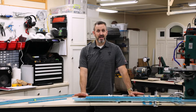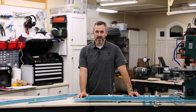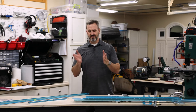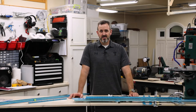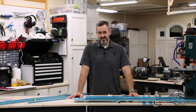I'm going to start building the empennage and I'm about to start making my first cuts, pound my first rivets, and do all that kind of stuff. The instructions for the empennage start you off building the horizontal stabilizer, and then the rudder — that's Section 6 and Section 8 in the manual. I have the parts for the horizontal stabilizer and the rudder right here in front of me. Most of these are the parts, and I have some skins down below that are a little bit off-camera.